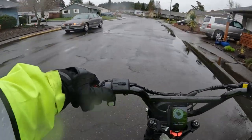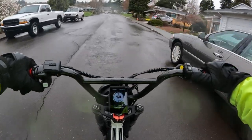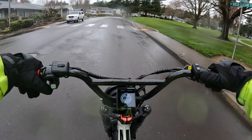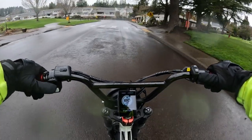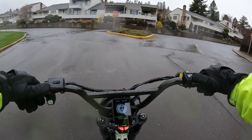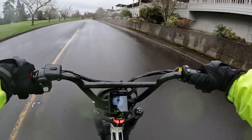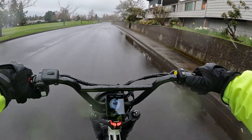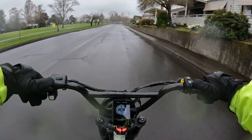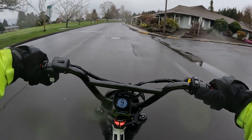So I wanted to test out with the new fuse. What happened was apparently the batteries, at least on the initial delivery of the bikes, had a battery with a 50 amp fuse. The bike controller peaks at 90, so as you can tell 50 and 90 don't correspond - 50 is going to be reached before 90 obviously, so that's where we had the issue. Now fixing it, the fuse we put in is 120 if I'm not mistaken, which far exceeds the 90, so there should not be an issue.